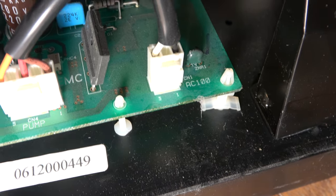Now I think we decided that green was ground and that blue should be 5 volts. I think that's the way it is. And that's the 5 volt regulator there. And the pinout on the 5 volt regulator, I think, is input, ground and output. So this link they've added appears to be on the ground track, and it just connects. It's like it's extra current capability. Maybe it was burning up on some of these. So that's ground. Yes, go with that. That's input, which is also fed out to this connector. And output, I think it's on that third pin.